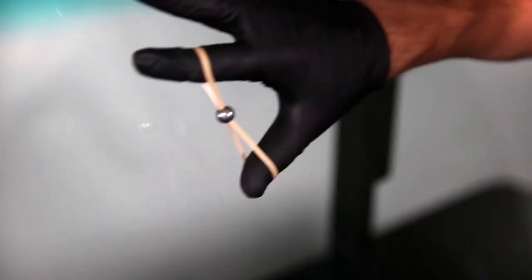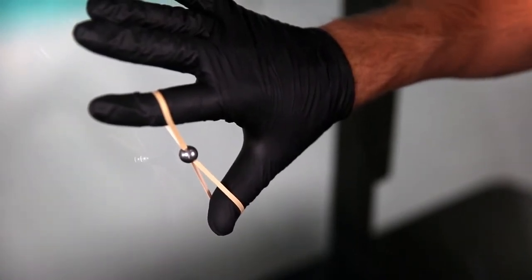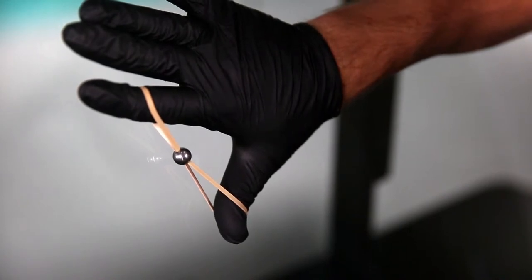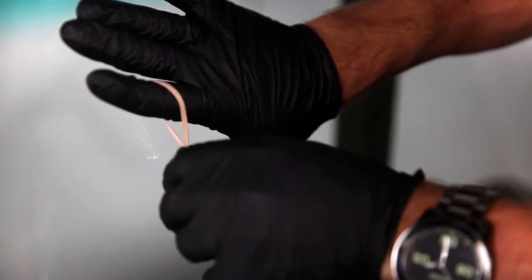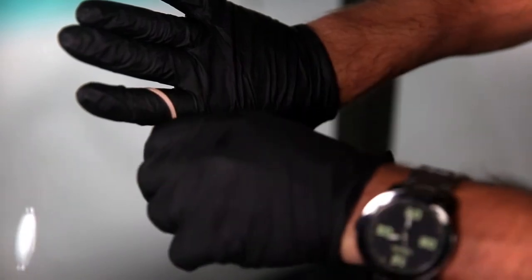To show you how to use the ball bearing bullseye maker to create practice damage: stretch your fingers over the windshield creating a little bit of tension, hold it right against the glass, then pull the ball bearing back and smack it against the glass. Usually it takes three or four tries before it actually creates damage.